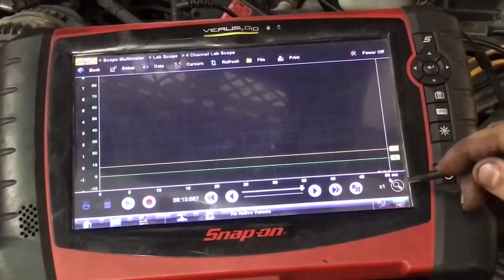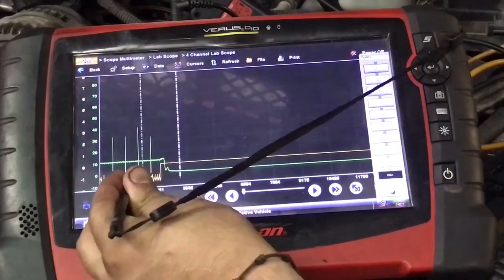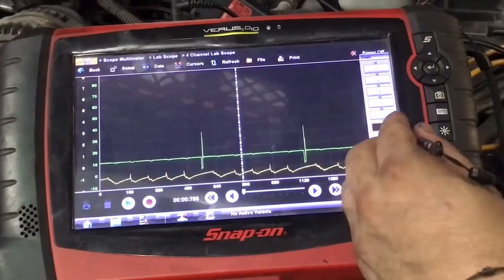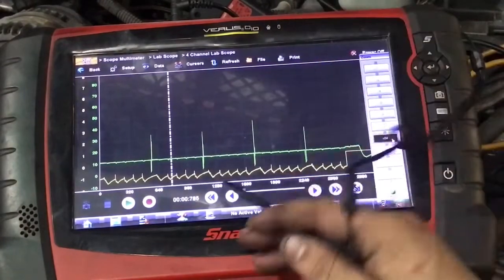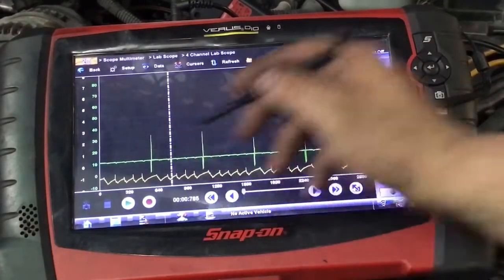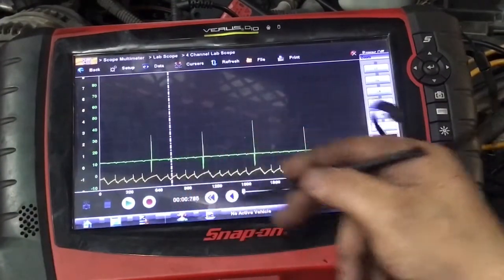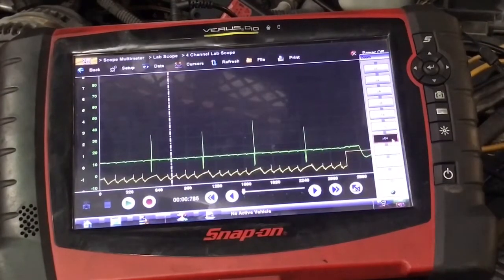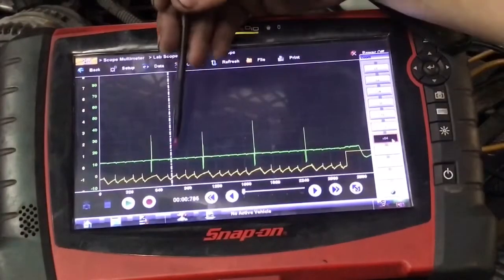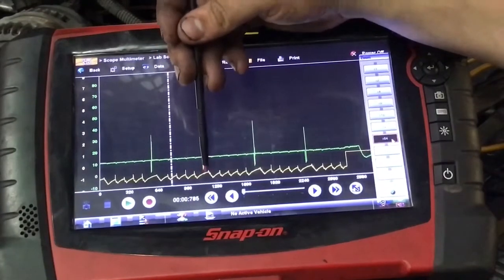Let's zoom out so we can see where our crank was at. Let's grab our stylus and zoom in just a tiny bit. If you can see these little bumps right here — nice bumps — and then we have this big old bump right here. But look where our trigger is at: trigger there, trigger here, trigger there, trigger there. As you can see, we don't have a little bump coming up right here. So I'm pretty sure this is going to be a mechanical issue. If we count these bumps — one, two, three, four, five — and this is where six should be, because this is a six-cylinder.